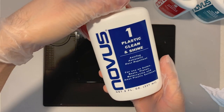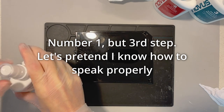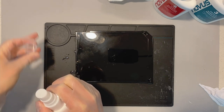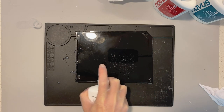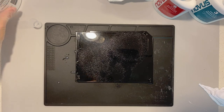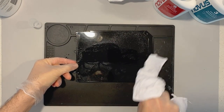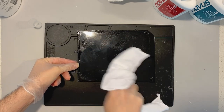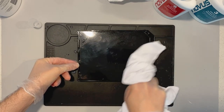Now on to the last step. This step — Novus No. 1 — is technically optional, but I'll do it. The idea is that this last step is more to clean, polish, and shine your plastics, as well as keep them more protected against scratches in the future. It's more effective when used for other types of plastic restoration like a car or motorcycle. But we're still going to do the right thing and seal this off. I use a brand new clean shop rag wrapped around my finger — a technique I actually learned from Japanese shoe shiner videos. If you haven't seen those, go check them out.